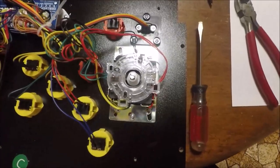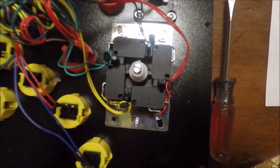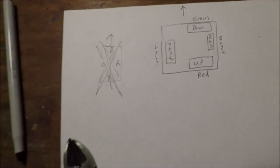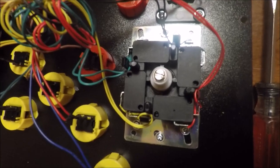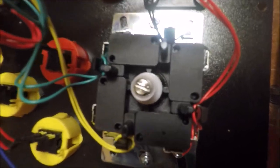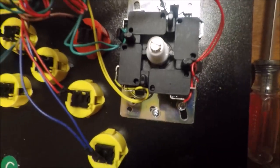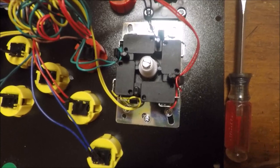With the control panel removed, if you look at this joystick, you can take off this gate — it has some clips. Take it off and you can see what color wires go to what micro switch. Make yourself a little diagram of what color wires go to what switch and which way that switch moves the character on screen. For instance, red is up, green is down, and so on.